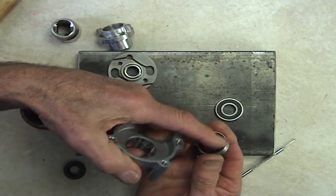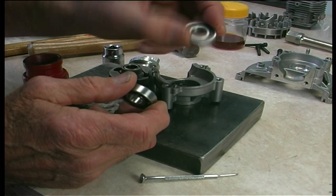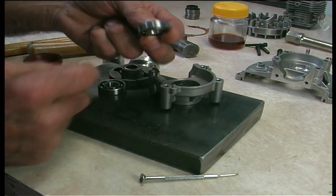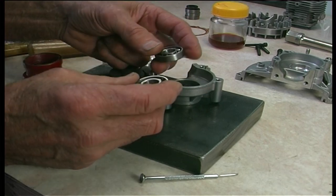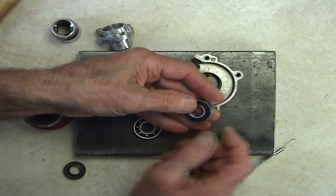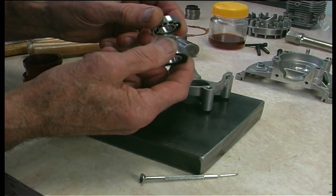This will provide a little bit more sealing here and lessen the chance of sucking air or a problem like that. We've got two seals/shields — the extra one there. The fuel mixture won't have a tendency to leak through into this one, which is quite handy. But you have to take both sides out like this to wash the grease out and then blow them out with compressed air — they have to be immaculate. Pop that outer shield back in; click back in. Your two bearings' open faces will face inward towards each other.